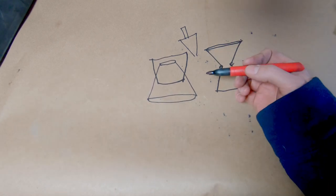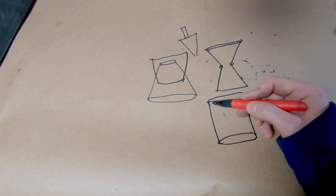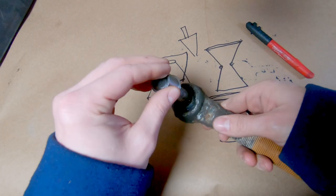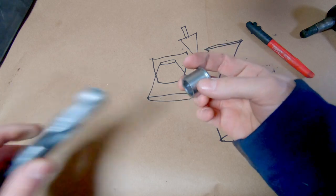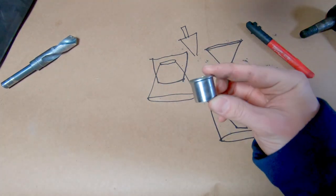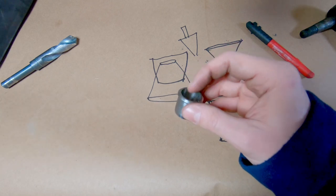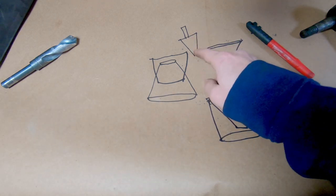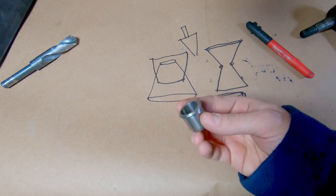The easiest solution in my opinion is to drill it out to a straight hole and then put an insert in that straight hole that has the taper. The inside of this insert is tapered — it fits perfectly on the end of the tie rod — but the outside is just a straight cylinder. So I take my three-quarter inch drill bit, drill through the steering knuckle, and put this insert in its place. This preserves the tapered interference fit while keeping the most material possible. Plus it's a lot cheaper than a tapered reamer, which is about a hundred dollar tool. I got these on Rough Stuff — you can also get them from Bronco Graveyard.